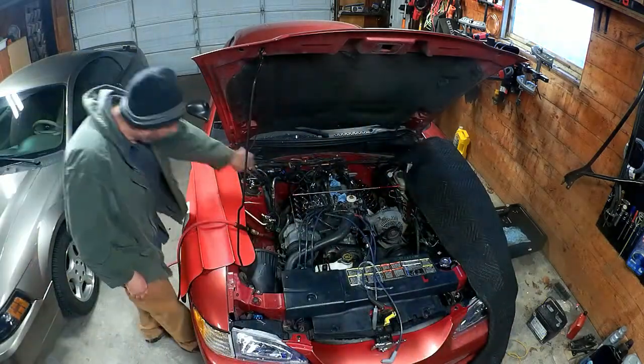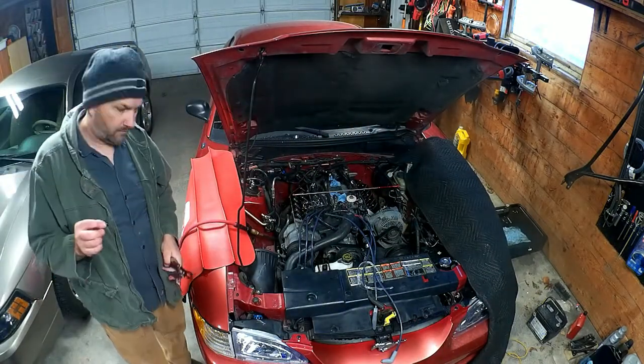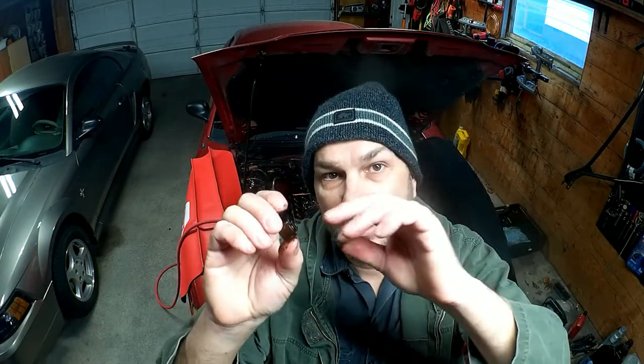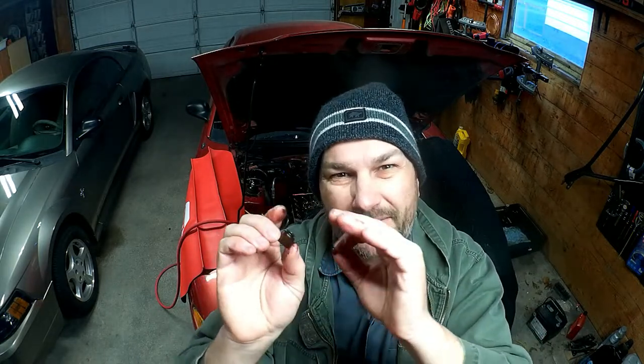So the next part is use some special pliers to pull up the old valve guide seal. So here's the old valve guide seal. Here's the little collar spring that goes around it. That collar spring is meant to just hold tension continuously on the rubber collar, and that way, even if the rubber gets molded or smashed into a shape where it's not holding tension around the valve stem, the spring is supposed to still pull it in.